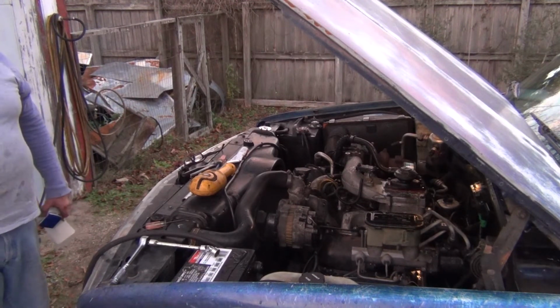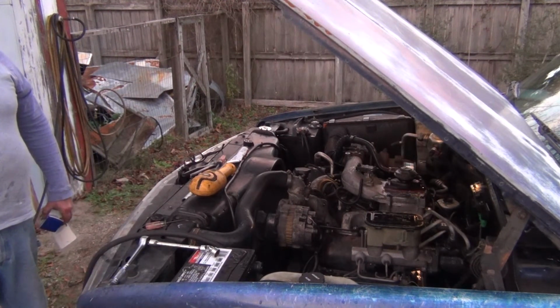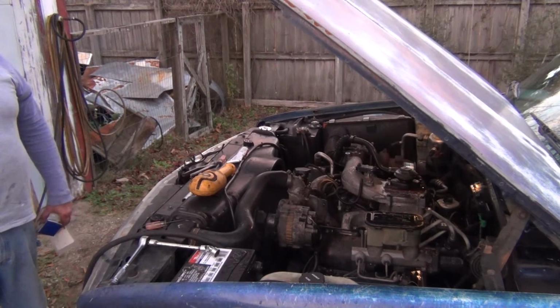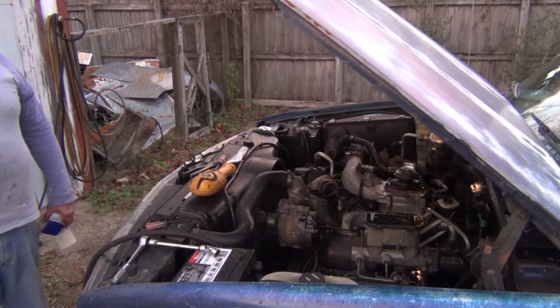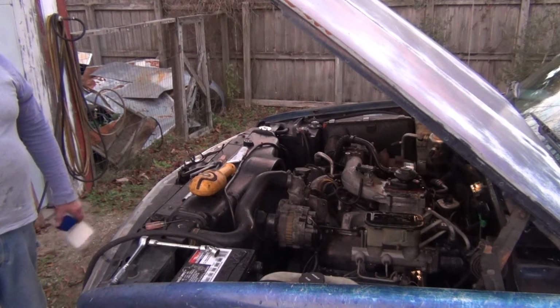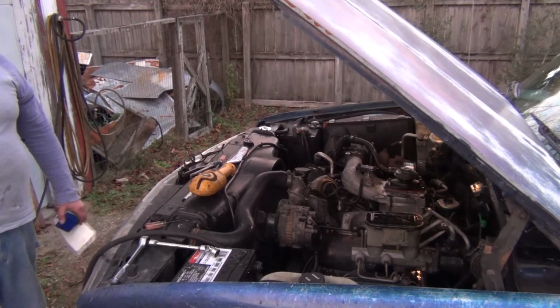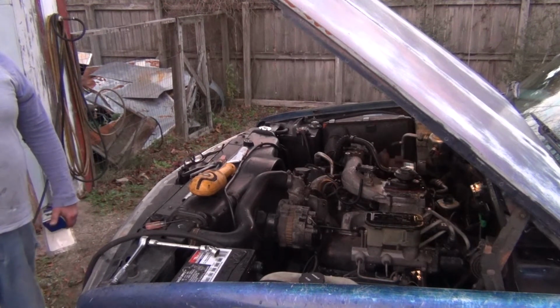I'm still looking for a front drive shaft for it. And I have one little brown wire that needs to be hooked up that somebody snatched out. The wiring was a nightmare on this truck. I had to buy a special program for a computer from a Swedish guy, and the stuff to make a diagnostic cable to plug into my laptop. Works great. You can't set the timing on this truck without this program or one like it. Anyway, it's a weird truck. First year of the computer controlled injection pump, or DS4 as they call it.